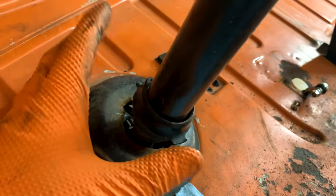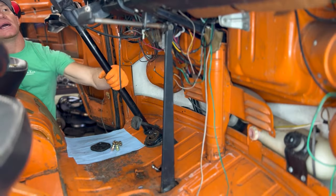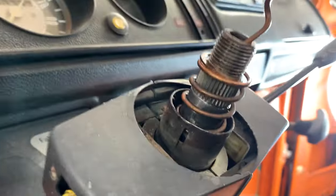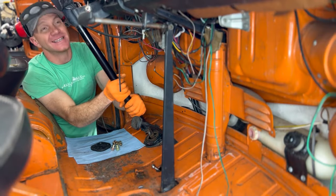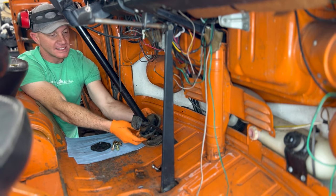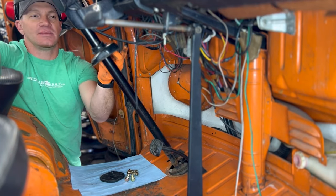On earlier buses that have this column snap ring — plastic snap ring — it's super easy to bust that. To get down here and remove this, you have two screws on either side. Once you get those, the thing is still locked in. So once you have taken your steering wheel off, grab the actual column and just twist and turn it as you're pulling up on it, and you'll see it coming up. Your key needs to be in the on position to do this, and of course the battery disconnected. We're getting this up high enough to clearance the area down here.